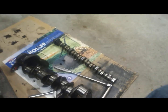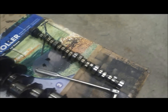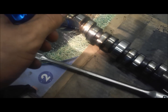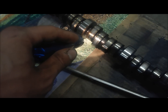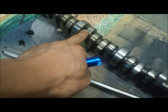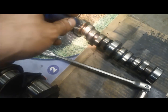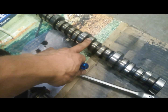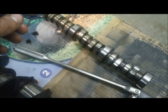Taking a look at the camshaft — depending on how the rest of this goes, we may or may not reuse it. This particular camshaft is what I would deem worn out. These roller cams do get a little bit of wear, and you can see where the lifter roller runs along and then when it starts to ramp up on the lobe and the spring pressure increases, there's actually a dip on all the lobes right here. It didn't wipe a lobe, but I wouldn't say this cam would have lasted 50,000 more miles — eventually it'd start getting past the hardened surface and wear out.